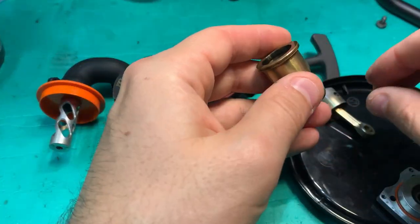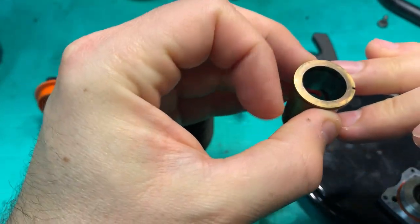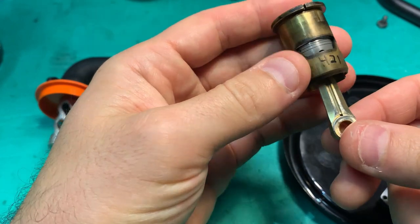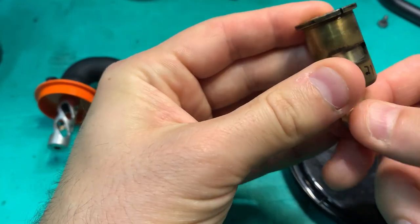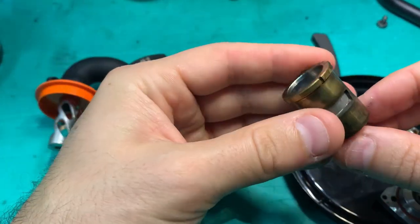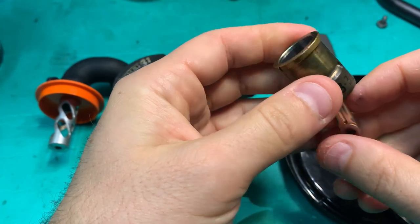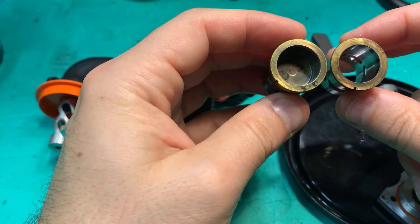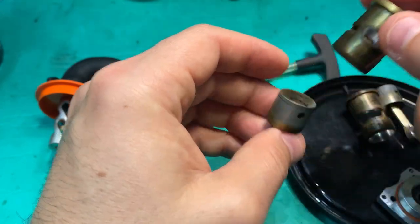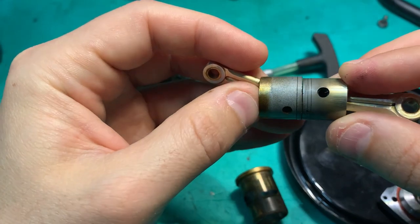We got the piston and sleeve back for the Hyper 21 being repinched. So they put our ER collet around the sleeve, which comes from all angles at the same time because it's screwed on from the top. So while this had no pinch at all, now it's come back and it's got a lot of resistance. So that should start up and run good again. And also we got the 3.3 back as well. And again, you can really feel the pinch as it gets towards the top of the stroke. And one other thing that I found interesting, if you look at the 21 and the 3.3, the 21 is much skinnier than the 3.3, even though it's a much larger engine. See? Look at that. The 3.3 has got a bigger bore.